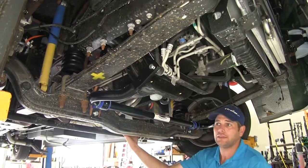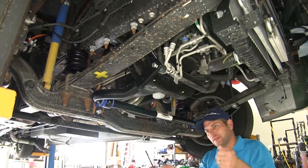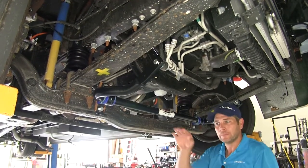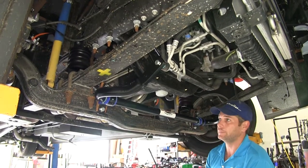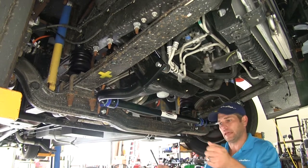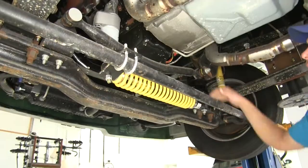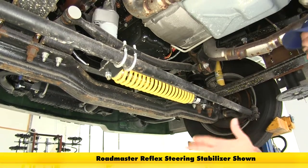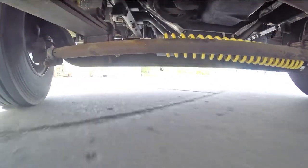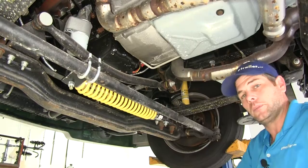With the heavy tires on RVs, uneven road surfaces or a slight lip can cause the tire to follow along, and what they call rut tracking — the grooves in the road that push the RV side to side. This can also be affected by body roll from passing vehicles or uneven pavement. Your steering wheel can wander side to side, and that's where a steering stabilizer comes into play. It's designed to absorb shock from the steering wheel, especially in a blowout situation — if a tire blows out, it's going to immediately try to turn that way, and the heavy duty shock absorber helps lessen how much it moves.